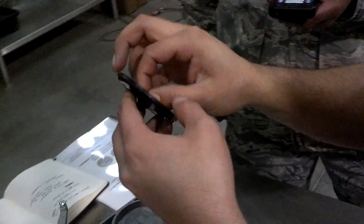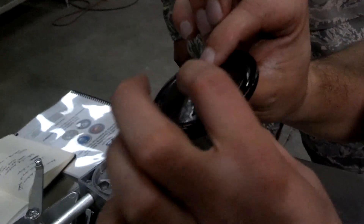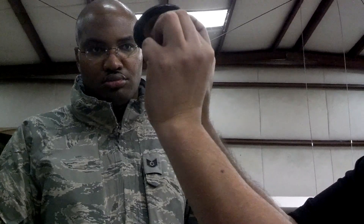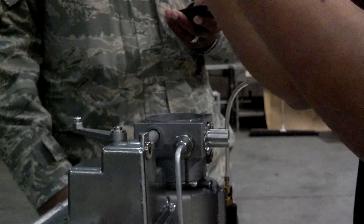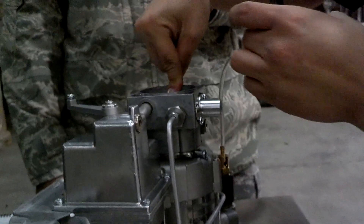The other thing you want to make sure — this is a little bit of a trade secret here. If that tip isn't pulled all the way through, put your finger right here. Feel that air gap right in there — see how it's lifted? What that does is it puts this tip closer to that hole, so now it's sealing it. This amount of space right here puts it at the right height to make sure that the fuel is circulating. Now feel it — see how it's nice and tight on there? There's no air gap. With that air gap, it essentially makes that tip grow, so it's closer to that hole and sealing it, and now you can't get fuel in.